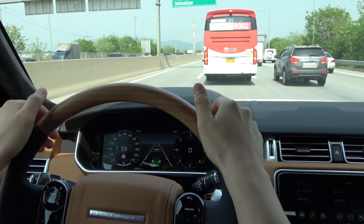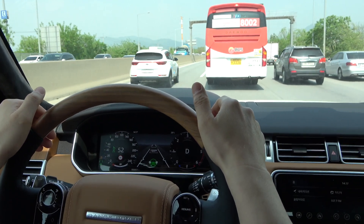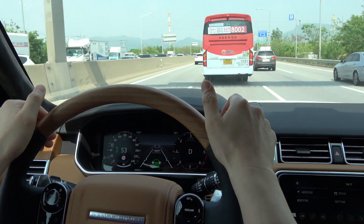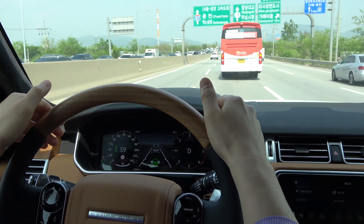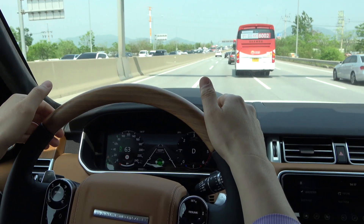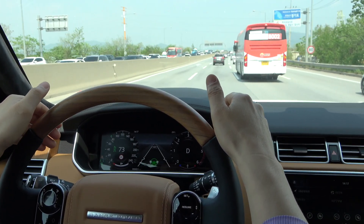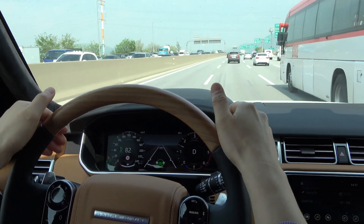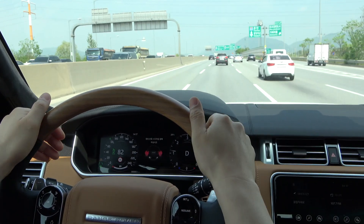In this video, we only hold the steering wheel for a moment when we hear a beep. If you hold the steering wheel, you will feel the force of continuous movement as if someone were holding the steering wheel to help. It feels stable because the power is transmitted not only when the steering wheel needs to be moved, but because it constantly senses fine movements. If necessary, the driver can override by moving the steering wheel with direct force.